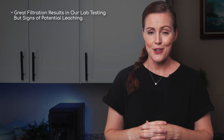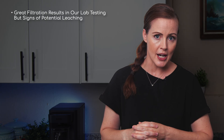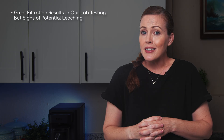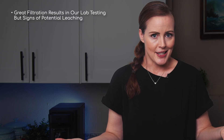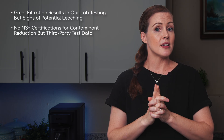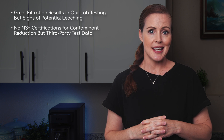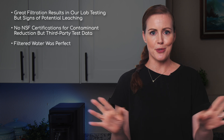So here's a quick summary of the SANS water purifier. It achieved great results in our lab testing for contaminant reduction, but our unit may have leached methylene chloride into the water at a concentration just below the strictest health guideline. Technically it shouldn't pose a health risk, but it doesn't exactly inspire confidence either. There are no NSF certifications for contaminant reduction, although SANS provides third-party test data covering several heavy metals, salts, and a few other contaminants. Our filtered water tasted and smelled absolutely clean, and the system uses standard RO filtration plus UV disinfection for added germ protection.